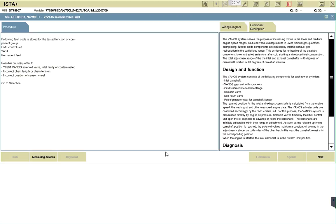So just in case, we want to put those things new on it, and then our only option now is to set the timing properly so that it syncs with the crankshaft, and then it doesn't give us that code anymore. If it gives us the code again after we make all those corrections, it has to be that it's not done properly. We have to do it as if we are doing it at the dealership. Hello? Yeah, I'm here still. Yes, we have to do it just like as if we were working at the factory and putting the engine together. You know, we have to have that kind of a concept in our heads when you're working on the car on your own. You have to have that kind of a built-in.